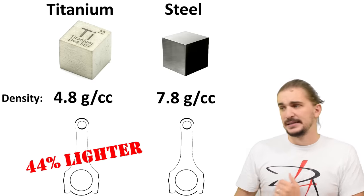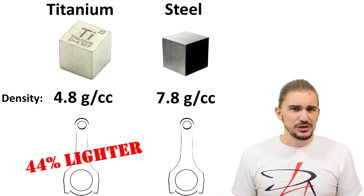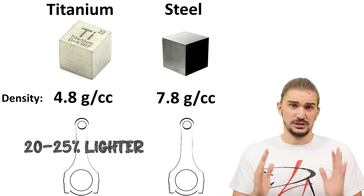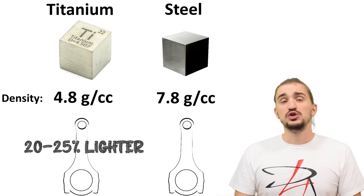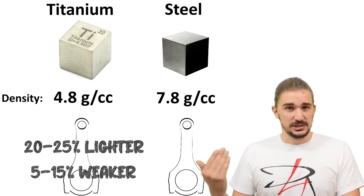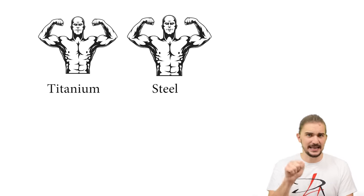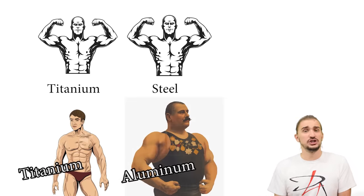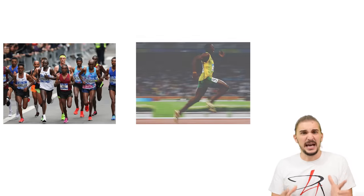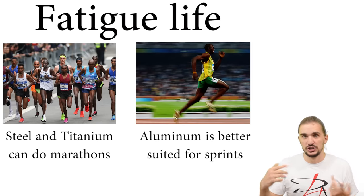In practice, titanium behaves a bit differently to steel and connecting rod design must take this into account, so on average titanium connecting rods are usually 20 to 25% lighter than a comparable steel rod. Although there are some impressively strong titanium rods out there, on average titanium rods sacrifice a bit of tensile strength compared to forged steel rods — roughly 5 to 15% weaker. However, titanium rods don't need to be super chunky like aluminum rods, actually looking pretty similar to steel rods. They also have a fatigue life better than aluminum rods — many titanium rods have a fatigue life similar to steel rods, meaning you can use them in a daily driver without worrying about measuring rod stretch periodically. As they heat up, titanium rods don't expand as much or as fast as aluminum rods, so you don't have to baby the engine as much.